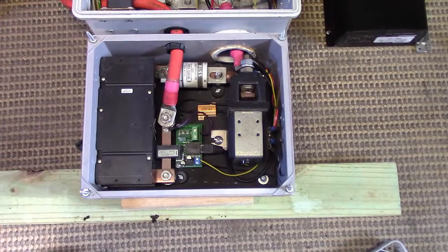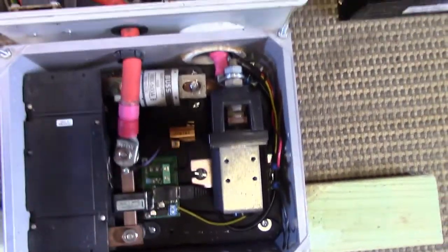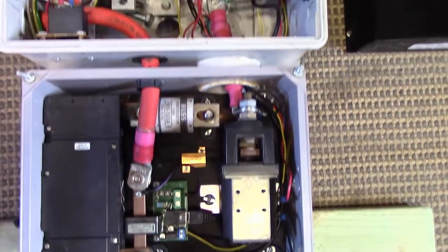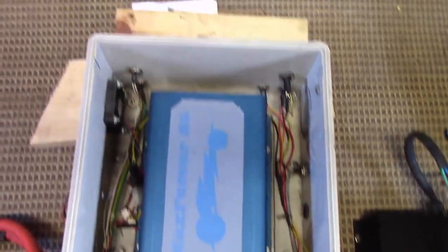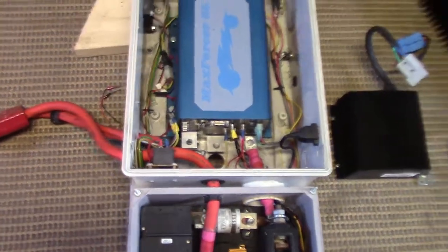It never worked quite right here — the current measuring didn't work right. I used it for voltage, temperature, and some other variables. I think it's because inside this box, with this heavy-duty contactor and a lot of EMF coming off the magnetic coil, it interfered with the current sensor. In my next build I'm gonna move it out somewhere where there are no coils around it — probably on one of the bus bars for one of the batteries. And this thing here is just a high-power pre-charge resistor. That's the controller box — it's a 1000-amp MOSFET air-cooled controller.